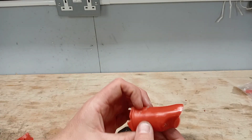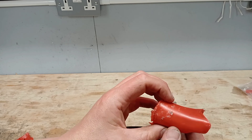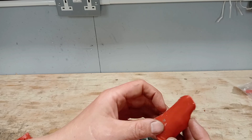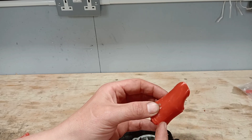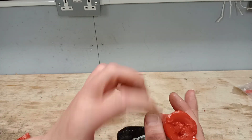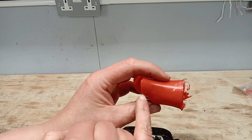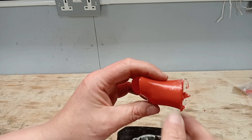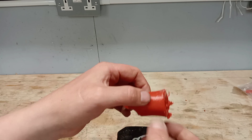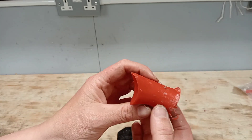There we go — so that's a cast of the exhaust port. Your window again looks fairly good, just this bit here I'm not happy about. I can really see me making an insert to possibly restrict this outlet a little bit more, make it a little bit narrower and get rid of this. I don't really like it — I think that's going to be detrimental for flow. I want that to be more uniform, but that's the job for a future video.